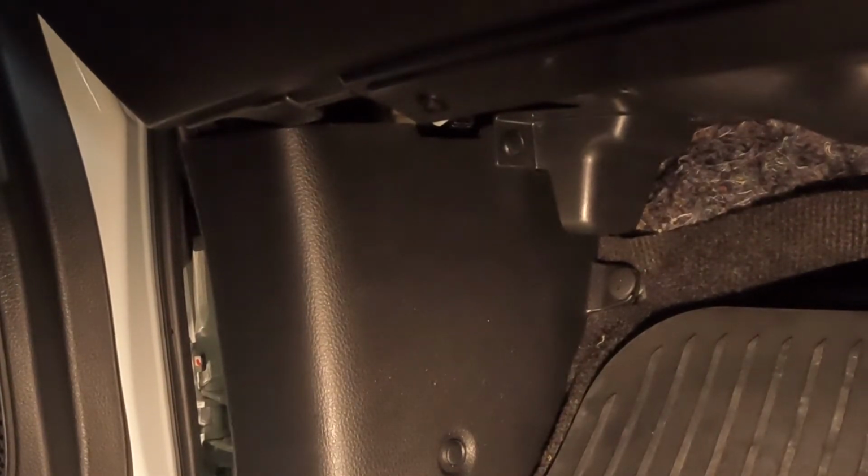You come up to this footwell here, and we'll take this trim off and I'll show you where it goes to. This trim just pulls up. Feels like you're going to break it, but that's the way it's designed to work. So just here is the kick panel that you need to remove, and there's just this little grommet here. You just pull the center, you lift the center out of it, it will come like that. And then there's just one more here. Okay, I think that one just twists out. Yeah, that one just twists out.